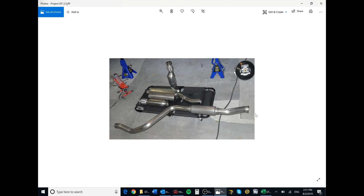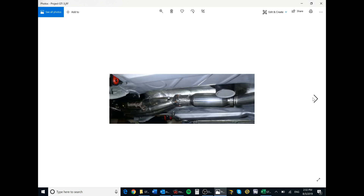Here are some of the other components. This is the Tectonics two and a half inch primary exhaust pipe, which has its resonator built in; the other end connects to a muffler. I had two options: a catalytic converter with flex pipe, or a Vibrant stainless resonator with flex pipe as an alternative. Then a Borla muffler — it's a straight-through resonator with no baffles anywhere. This is the installed configuration: race header coming down from the engine through a flex pipe into the Vibrant resonator, then through the Tectonics resonator and onto the Borla muffler.